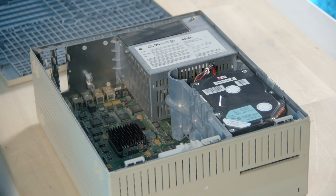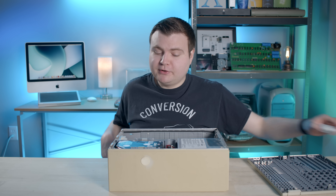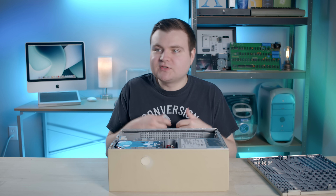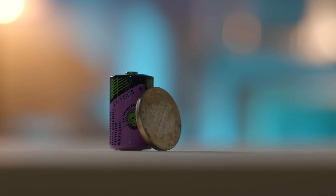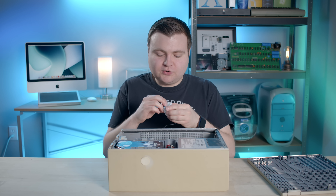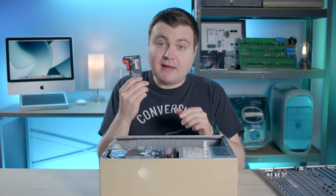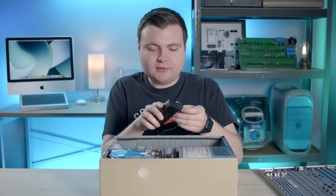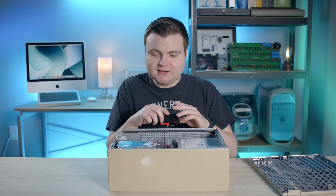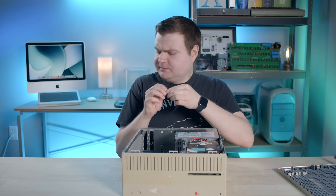We have to take this carrier out because the battery needs to be replaced — this is just good practice. If you have an old Mac, it's probably a good idea to put a new PRAM battery in there. Batteries will corrode over time, and if they leak — some people say it's a matter of when, not if — they will damage your logic board. So it's best to take them out if you're going into storage, or at least put in a fresh PRAM battery. I have a link in my description. I found a popcorn seed in here — no idea what the heck that is.